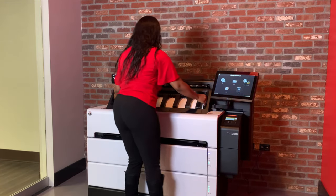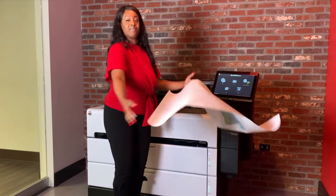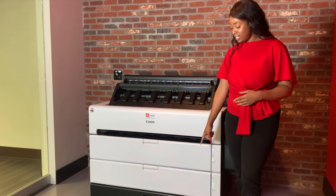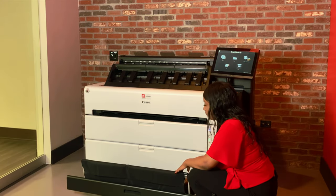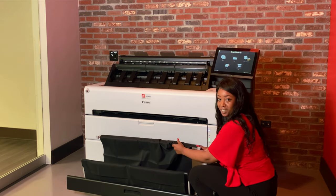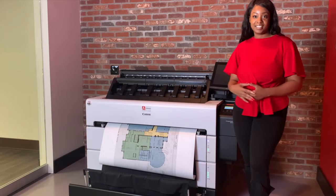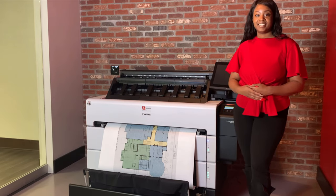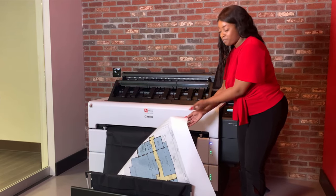Go ahead and hold both sides of your document and pull up. You also have another option of printing to your front stacker. You must first go ahead and assemble your front stacker — open it up, find your two more pieces here and attach it right into your front panel. The plotter can also print different materials and therefore provides you with more options in printing with greater production output. Your document printed out of your front stacker.